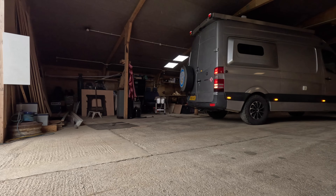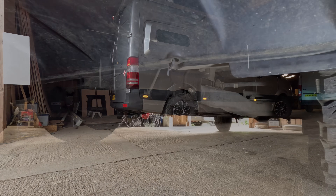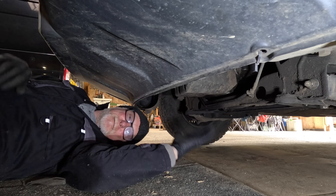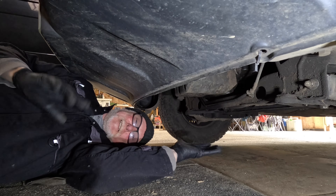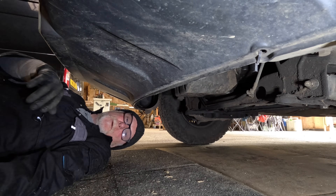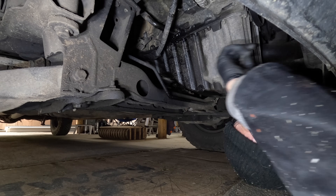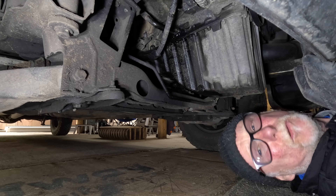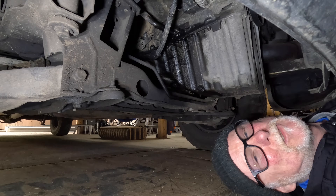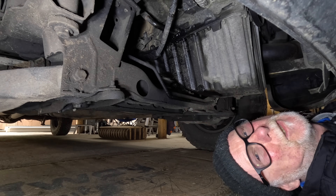Let's get my van in the workshop. It's a little bit tight under here, but there's plenty of room - plenty of room for an oil tray. I've no need to jack the van up, I can get to it easy enough. It's a little bit oilier under here than it was last year. Looks like I've developed a leak in the oil return pipe from the turbo. It's not too severe, but we'll have to address that. Now I know it's there, first let's drain the oil out of the sump.